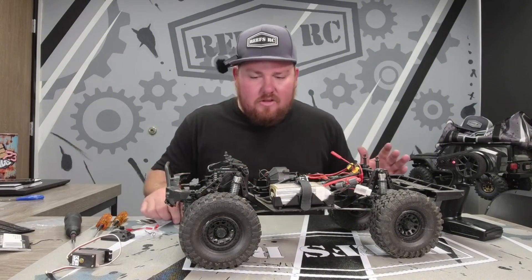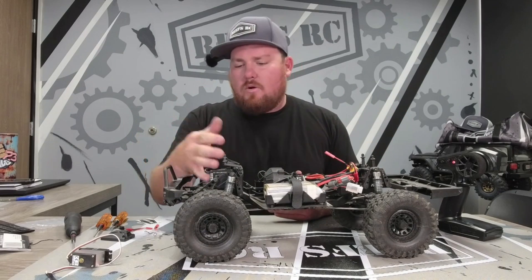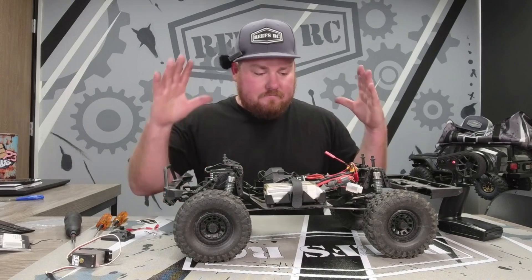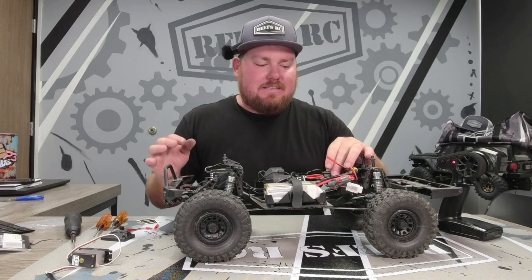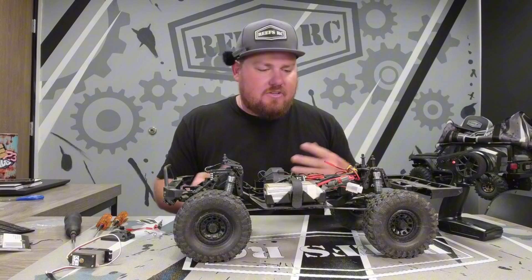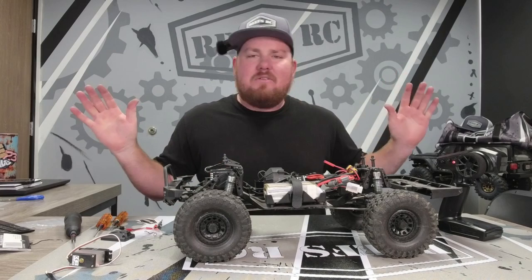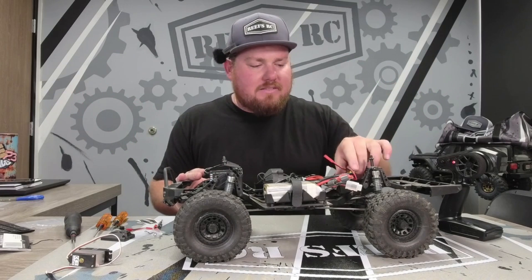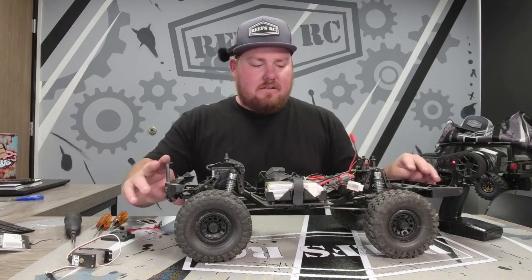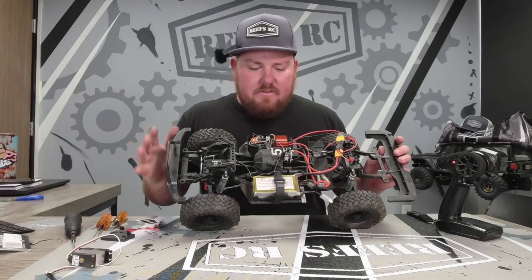All of the other stuff we did in this video was just hooking up the servo. The EZ BEC set to 8.4 volts took me a minute and a half to install. The best part about this - it is completely plug and play. Nothing's soldered. There's no new connectors. All of the factory stuff is reused. I retained all of the factory stuff here because it is a loaner rig. I put a long neck servo horn, which is on the website - it'll be linked in the product description below, along with the fully programmable black RAW 500.